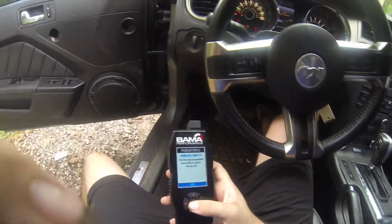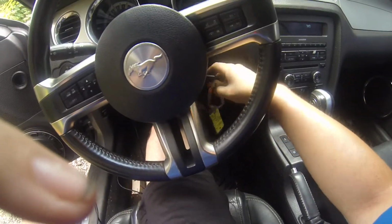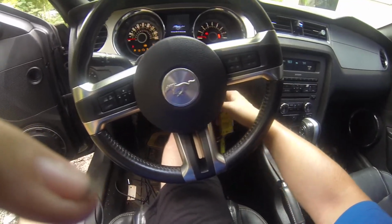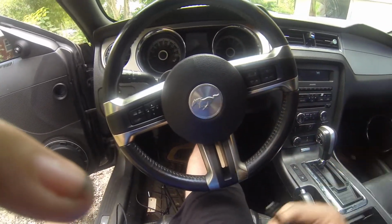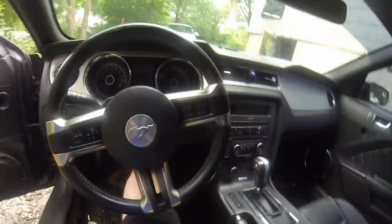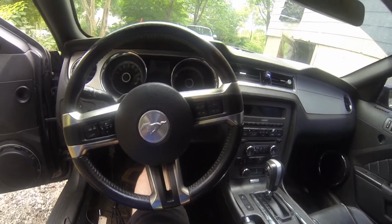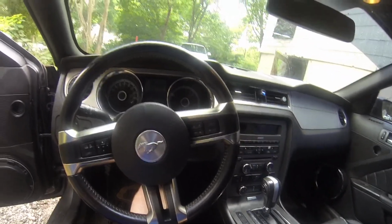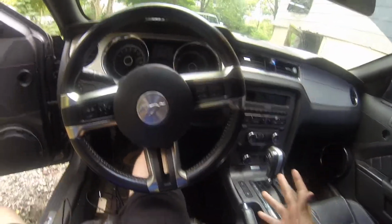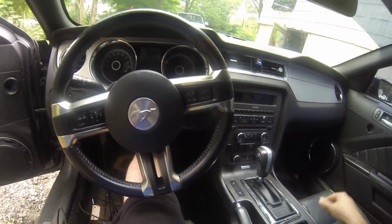Turn the key off, and then you crank it right up. And then if you have the ghost cam tune, what you would do at that point is you'll let it run for a little bit. Don't rev it up, nothing. Just let it sit there and idle for a couple minutes, and then after it warms up, give it a throttle up to like 2,000 RPM, and at that point the ghost cam should kick in and you'll start hearing that lopey, heavy sound that sounds really good.